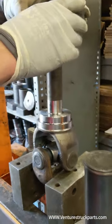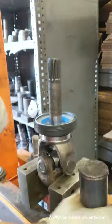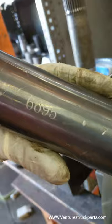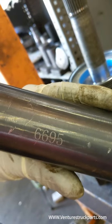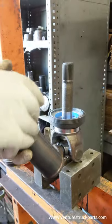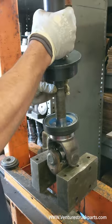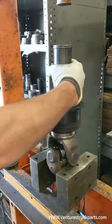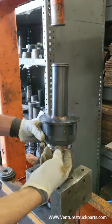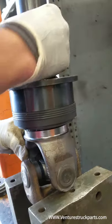So we get it set up, you're going to put your vacuum seal on — Dana Spicer — and then we use this tool. It's made for this, it's part number 6695. We just got it on the internet. We recommend always using this tool so you don't bend this seal. Pretty simple — you slide it over that outer shaft, and I always spin it like this to make sure you're lined up and not cockeyed or crooked on there.